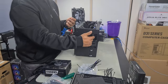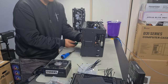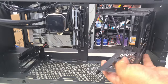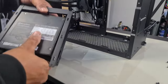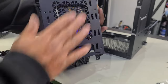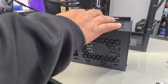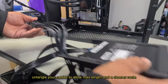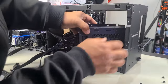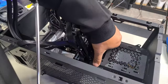We need to remove the power supply cage — there are two screws here to remove and two more on the inside. Once removed, lift it straight up and take it out. There are vents at the top where your fan goes, and screws here to hold the power supply in place. Power supply installed and ready to go. Before doing that I strongly recommend plugging in your cables first as it's going to be a pain once it's all in. Plug in the ATX cable — in. SATA cable can stay there. Now reinstall the power supply: get the two tabs into the slots on top of the case, slowly fold it back down until it lines up with the screw holes. Let's tie this down.